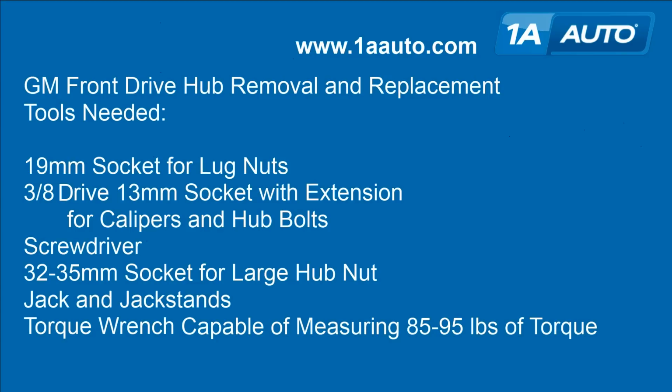Here's the list of tools you need for the Grand Prix. Really what you need is basically metric sockets from 13 millimeters up to 19 millimeters, plus the large hub nut socket, which is anywhere from 32 to 35 millimeters, and then throw in some penetrating oil and a hammer and rubber mallet. And if your hub doesn't come apart as easily as the one did in this video, you may need an axle or a gear puller.